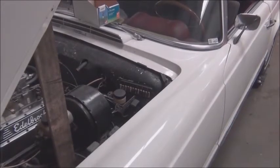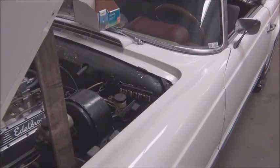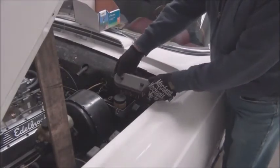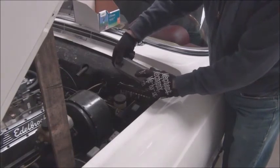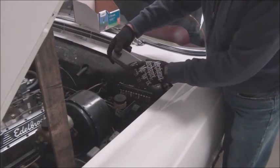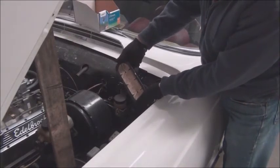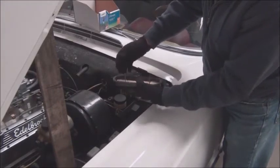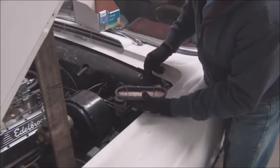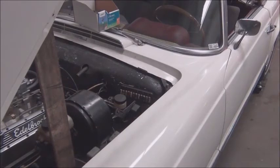So I was getting ready to pull the fuse for the fuel pump. And this is the cover right here. One of the screws was missing, but I happened to see it laying down there, so replace that. Inside the cover here, there is both in English and German, the legend of what's what. Fuse number 4 is going to be the fuel pump. So we'll pull that. But I just wanted you to see what this looks like. So let me zoom in.